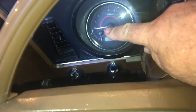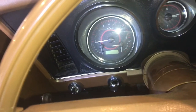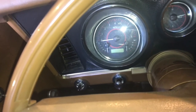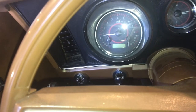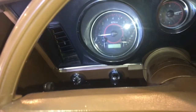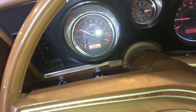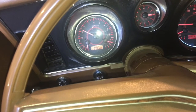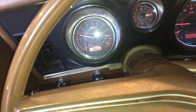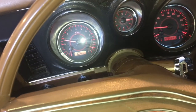My tachometer is sitting just below zero RPM, which is fine. When I start this engine, the choke should be set enough for the high-speed idle to have the cold idle engine RPM a little higher than 1,000 RPM. But notice what happens — I am manually holding the throttle open at about 1,300-1,400 RPM. If I release my foot off the throttle, the RPM drops down to about 700.